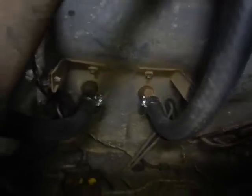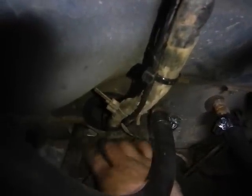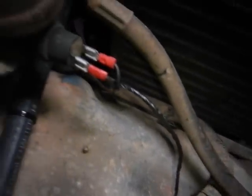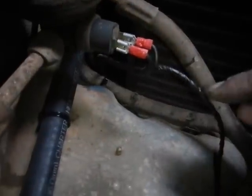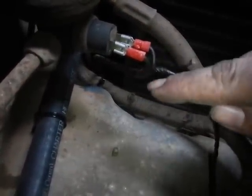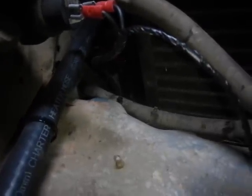I'm done under here now. From the main loom I've got an aircon trigger wire — you can see where the old one came through. I'm going to pull it completely out; the new one goes up in there, runs along here, goes to the pressure switch. It's a blue wire and two black wires go to the pressure switch for earth, and then that will go to a relay that will run the compressor, and that disappears up into the loom for the fans.